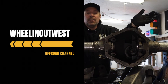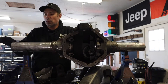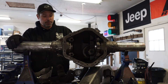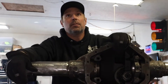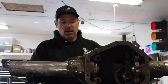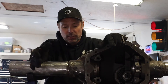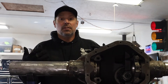What we're going to do is take this mid-80s style 14-bolt axle. I cut the ends off already, used the plasma cutter and cut-off wheel to cut all the brackets off, and got it all cleaned up. I also got a Dana 60 axle housing I found off Craigslist for only 50 bucks — a killer deal. I got the inner C and the outer knuckle salvaged from that axle and scrapped the rest. So this 14-bolt I got for about $200, and I'm going to combine it with my $50 Dana 60 to make a rear steer axle for my new project.